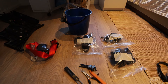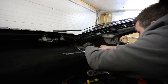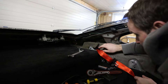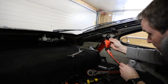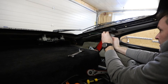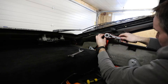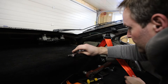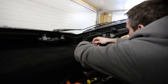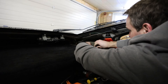There you can see the old belts and the new belts. Just slide this metal piece here back in the groove and make sure that the foam is not pushing on the belt so it will slide in and out easily. The black bolt has a spacer on it which makes this be able to move, so that goes on the top. Then later I'm going to torque them to 15 Nm - I'll do all the bolts at the same time so it goes a little quicker. There's a lot of foam on both sides so it's pretty hard - you kind of have to push away the foam to be able to get there.